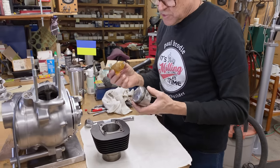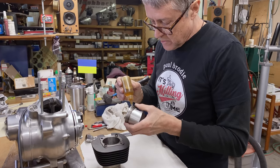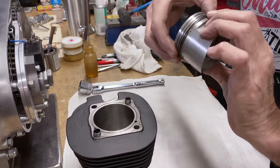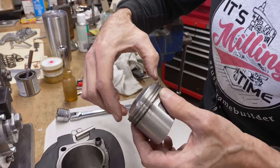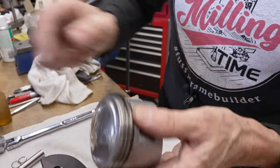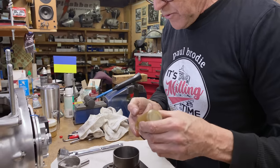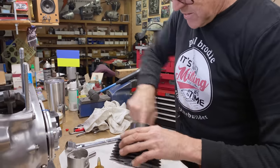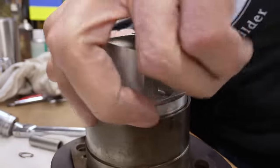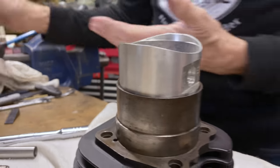I'm going to put a little bit of oil. I was shown years ago you'd smother it with oil, but I don't subscribe to that anymore — I think you need a little bit of oil but not smother it. So here we go, there's a ring gap — this ring gap is over here, and then this ring gap we'll put right there, so we got one, two and three, all staggered. I'm going to put a little bit of oil inside the barrel — just a little bit, don't need too much. Okay, the rings are in.